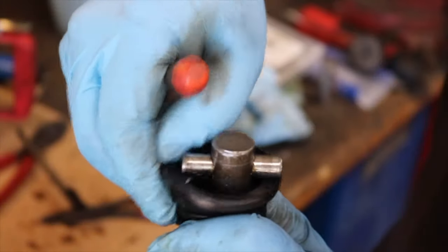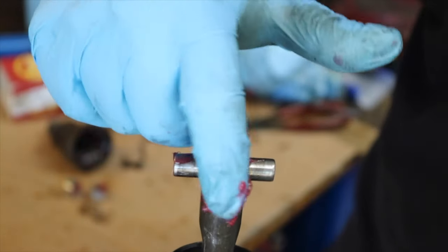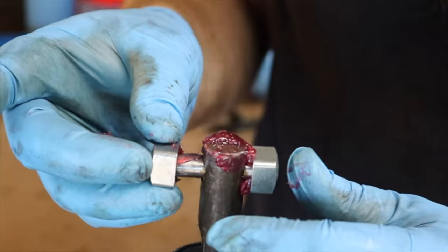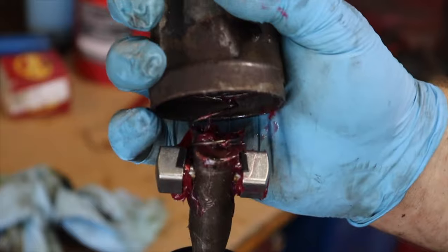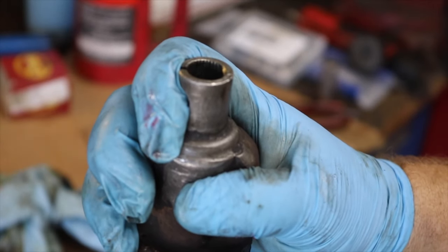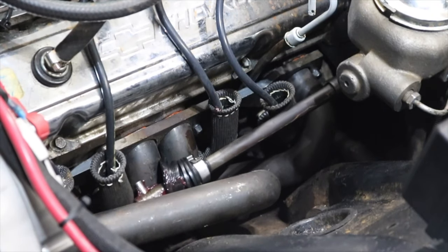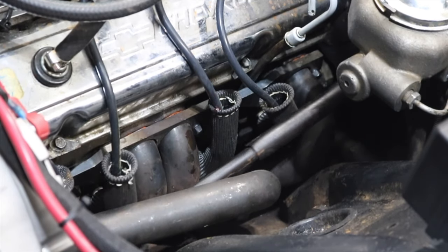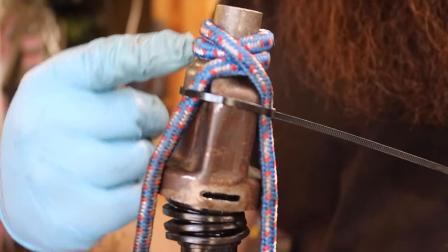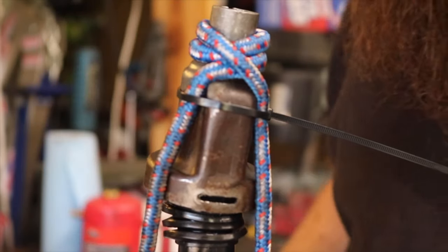Before we install all the other parts, we'll go ahead and lube up the tip of our shaft. Then we can slip on these little metal cubes and their spring retainer before finally sliding the housing over the top of the assembly. If you have headers, you might find yourself disassembling all of this to slide it in between the header tubes, but it is so good to make a dry run so that you know everything fits together. I got tired of fighting it, so I put a bungee cord to hold it down and a zip tie to hold the bungee cords from going away.